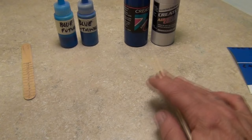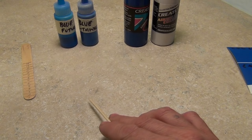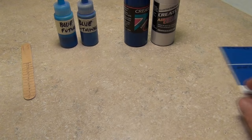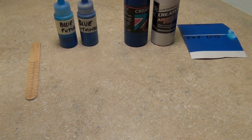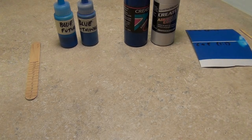The main thing to remember when writing or reading ratios: it's always paint then thinner, or paint then hardener, or clear then hardener then thinner. An easy way to remember is how you mix — you don't pour thinner first and then add paint; you always pour your paint and then add thinner to the desired consistency. Hopefully this clears some stuff up — talk to y'all later, bye.